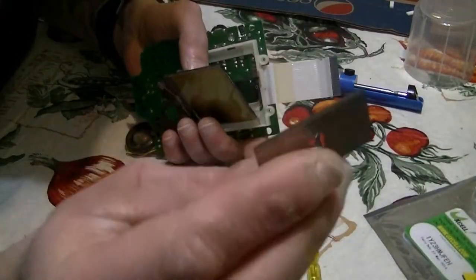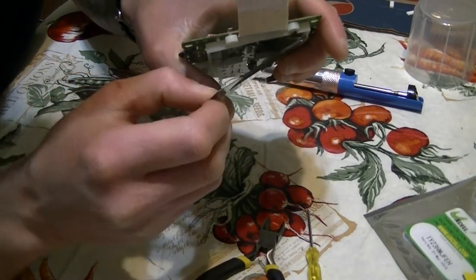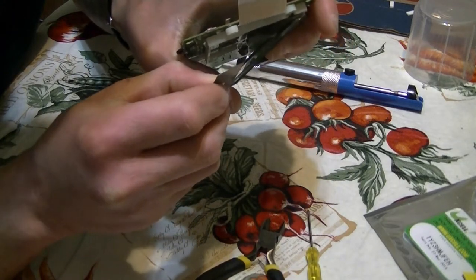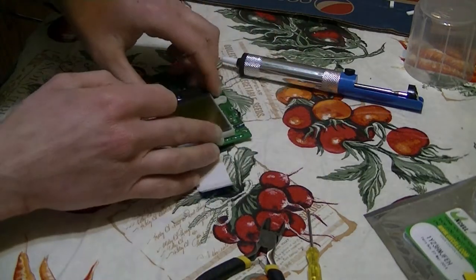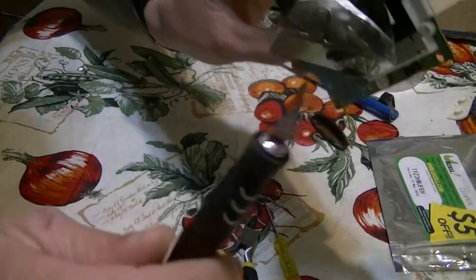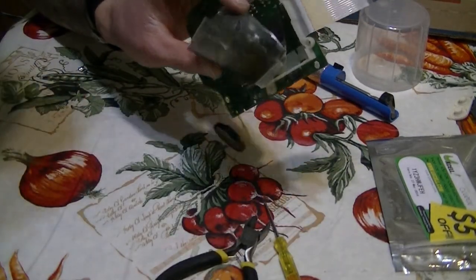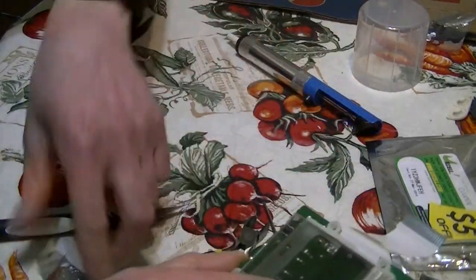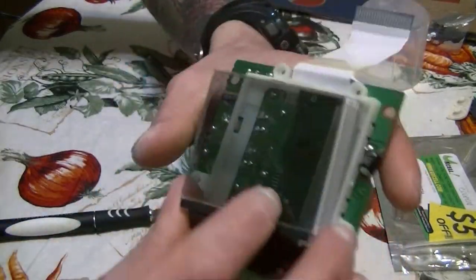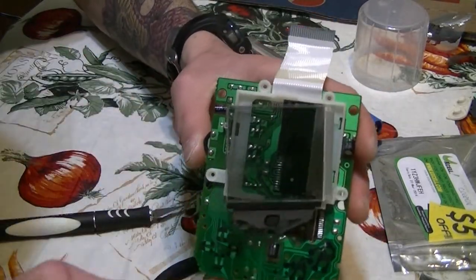You're going to need a thin knife when going in here. There are two layers, so make sure when you're cutting you get both layers. You want it to come out see-through and gray — that green still left is what you don't want. I actually found that using a scalpel works a lot easier because it gets deeper. You can find those for a buck at the dollar store. Okay guys — it's finally out! That's what it's supposed to look like. Grab some Goo Gone, rubbing alcohol, or Windex and wipe the residue off from the inside. Make sure it does not get on the motherboard.